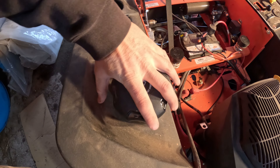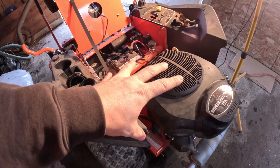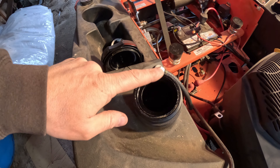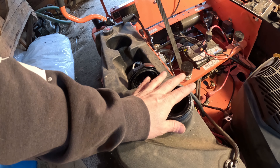What we end up doing is opening the fuel tank and peering inside. Half the time there's no fuel in there — make sure you've got gas in your tank. And please, I hear all the time it's brand new fuel, but brand new means it was sitting in a fuel can for two years. That's not brand new fuel. Fuel goes bad very quickly these days — even ethanol-free gas can go bad quickly. If that fuel is more than a few weeks old, it's not good anymore. Your car will burn it somehow, but these little engines do not like to burn old fuel. There's water in it, there's guck and muck. We'll suck up the fuel and half of it will be water. Put in new fuel and half the time they start. If it's been sitting all winter long with fuel in it, you've got bad fuel in that tank — let's get that fuel out.